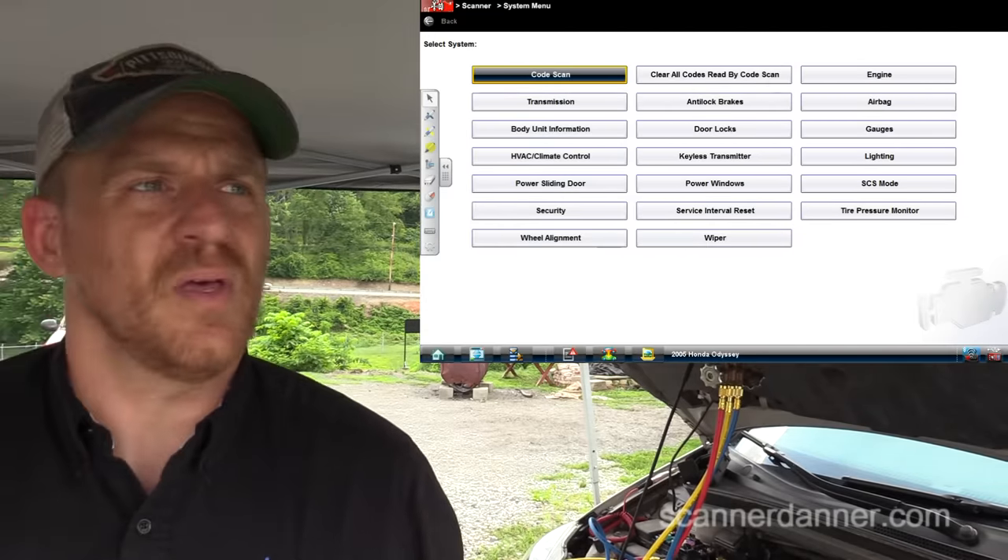If I'm correct in my analysis of the circuit — when I go back to my scan tool and command the output — connect the test light to that terminal. Watch: see that test light lighting? Yeah! So this is what you would do if you had a relay that wasn't functioning. We know ours is because it's clicking. But think how cool it is that I can take the scan tool and command this output on and off.